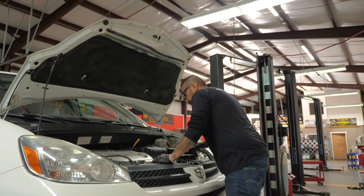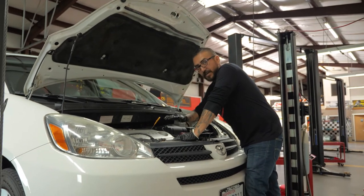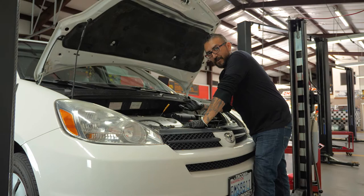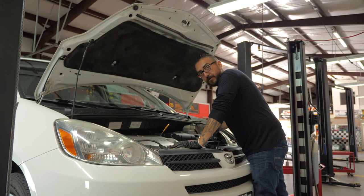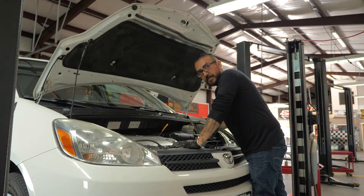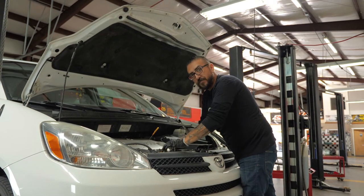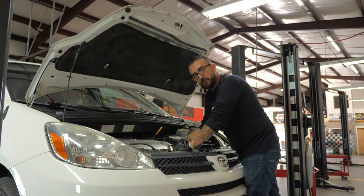In this particular vehicle, the oil filter is located directly in the front of the engine, right under the exhaust manifold. Ideally, you're going to let the engine cool down for about half an hour to prevent burning your arm. The filter is easier to get from the bottom, but most people are going to be accessing this filter from the top. I'm going to go ahead and access it from the top, but the camera will get you a shot from the bottom so you can see what's going on.